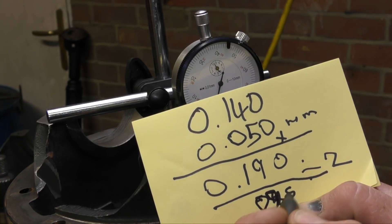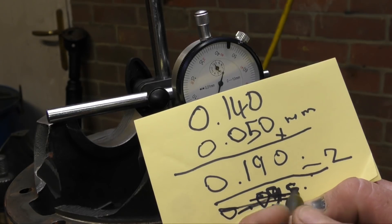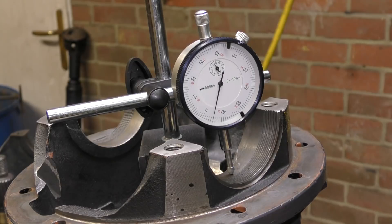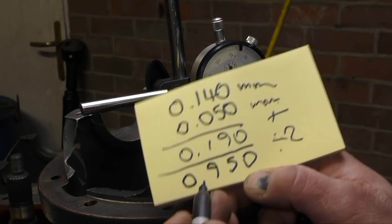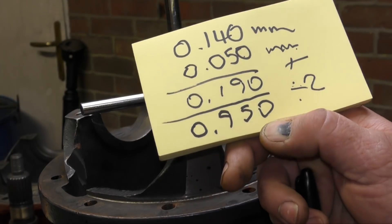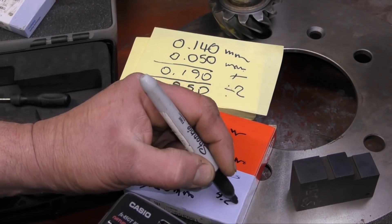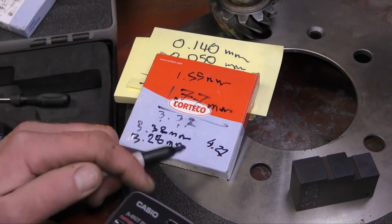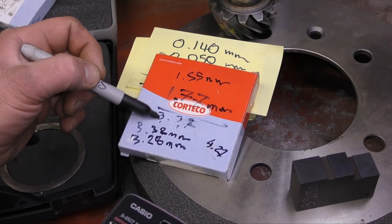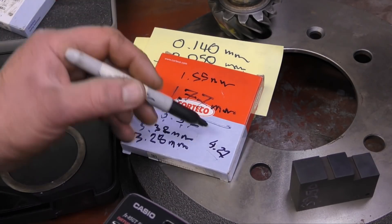This is one thing when you're doing calculations — if you were going to the moon, you'd have missed it by a mile. If you'd got it wrong setting a pinion head, you would have checked it again and it would have been wrong and you'd have to recalculate. I actually ran out 0.950 of a mil — big difference, which would have given me a shim bigger than I needed, or two shims at least, or even three. Check your maths, and make sure that you check mine as well.